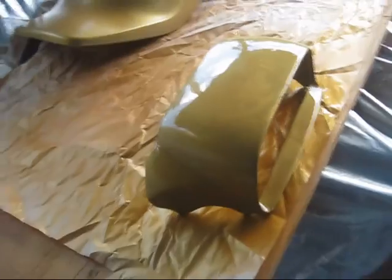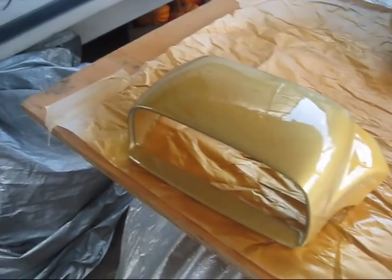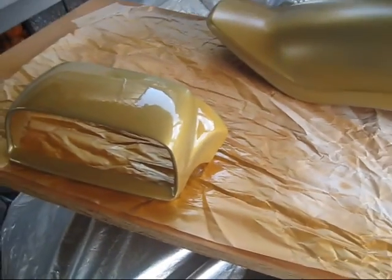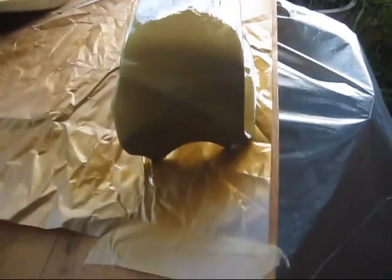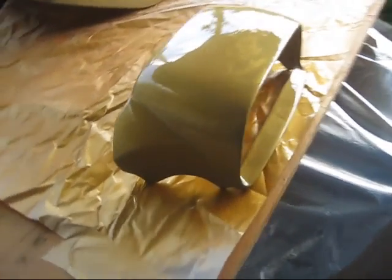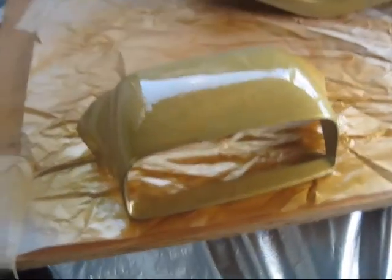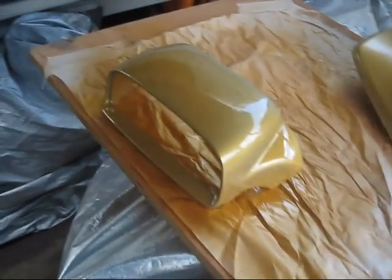And when you're looking at it wet, you don't realize that it's about ready to run. So just kind of hang in there and paint it with a pattern. Don't try to look. I mean, yeah, you can look, but your eyes will get fooled, but your hand can't get fooled. So you just have a nice, even, slow pattern. If you don't see it, no big deal, because when you get it out and you turn it around in different parts of the sun, you will see it.